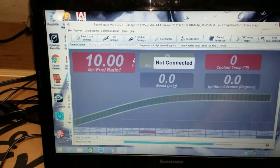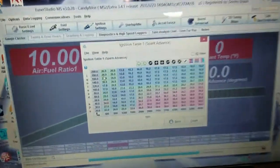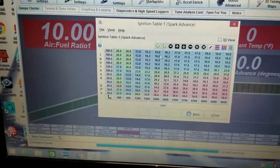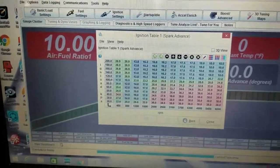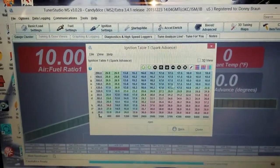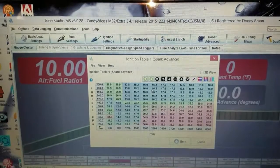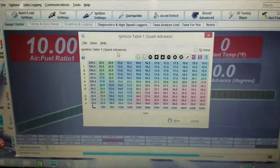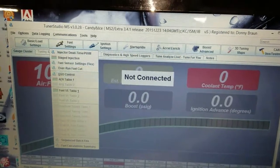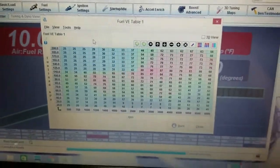Other items you're going to mess with is really just going to be fuel and timing. You're going to want to go into your ignition settings and go to your ignition table. Since mine is a turbo car, the settings are very conservative and safe, especially once you get over 100 kPa which is starting to make boost. My timing is pretty much locked in around 17, 17.5, and 18 at the max. This is a good safe timing table for now. For the fuel table, you really won't have to make too many adjustments to start — if anything make it a very rich table and then let autotune pull fuel out.